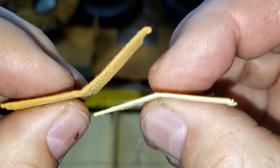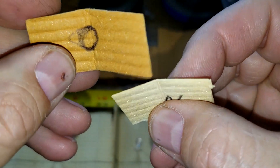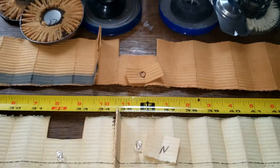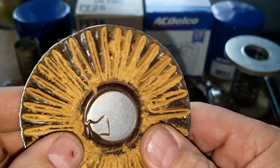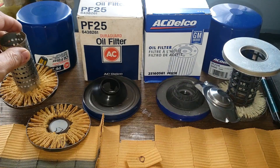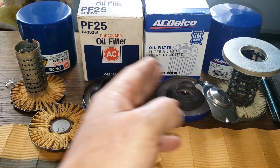You can clearly see the thickness difference — the old one is definitely thicker. I don't know what the micron rating is on the old one. I opened up this section so you could see the glue inside — they did get a little sloppy with the glue. I'm assuming these are vertically mounted filters because there's no anti-drain-back valve on the old one, but the new one does have one, so the new one was probably made for additional vehicles. This is the best matchup I could find.